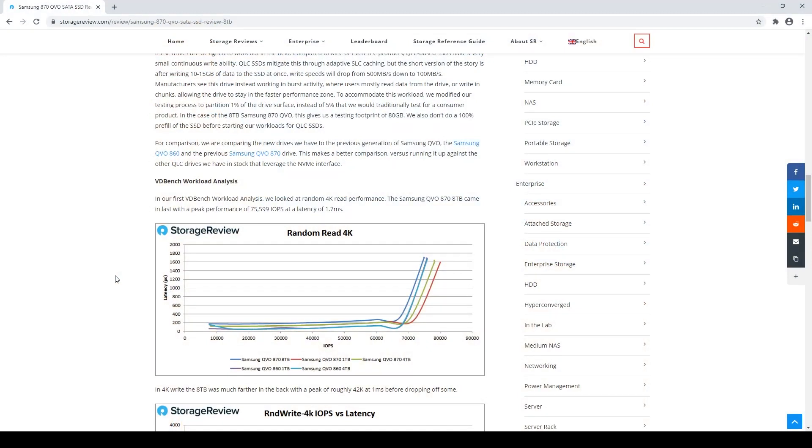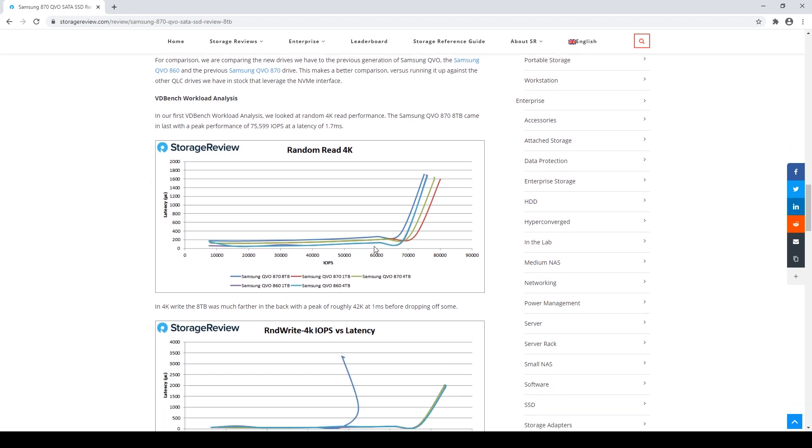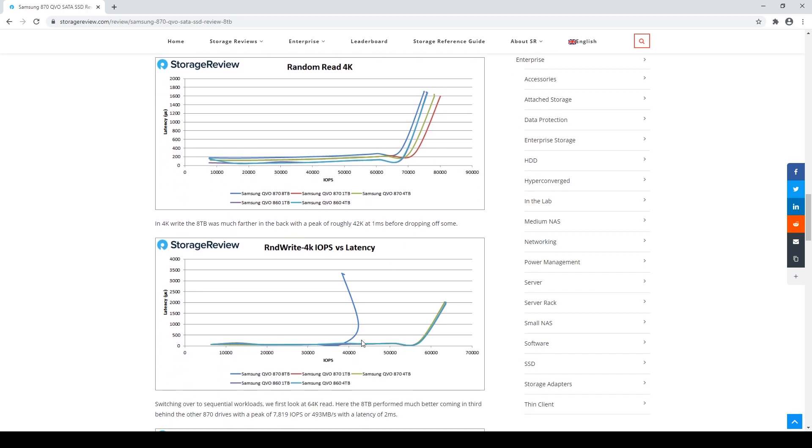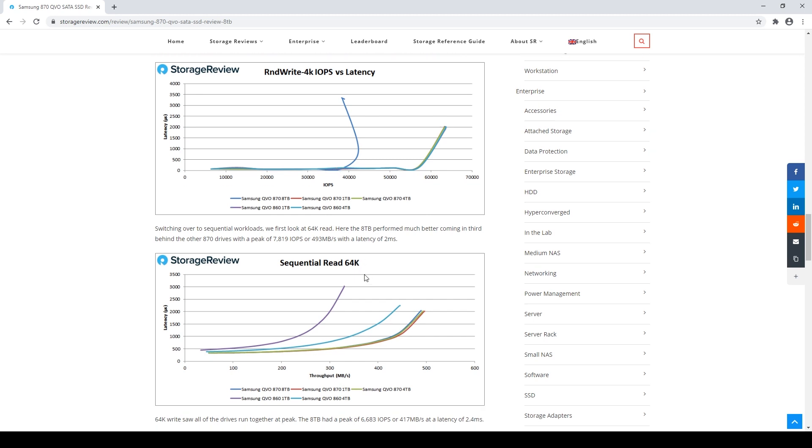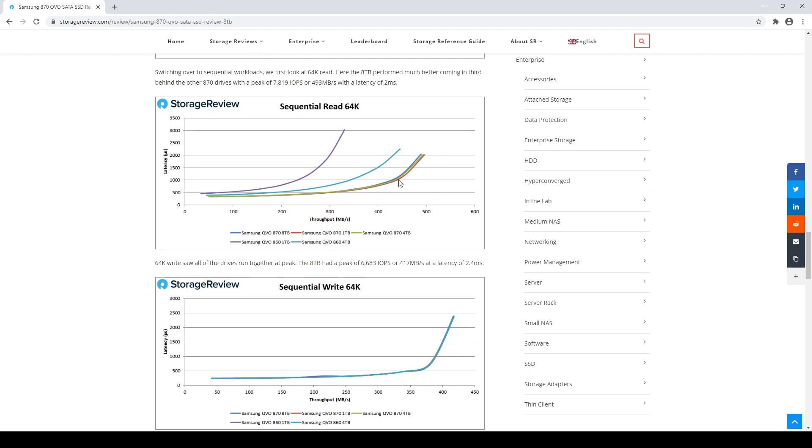Let's take a look at the performance. Overall, the drive starts out okay but then we see some erratic behavior. The random read performance is pretty good — it levels off closely with the other QLC SATA Samsung drives. The random write performance, though, really curves off compared to where the rest of the group comes out. We've seen this before where certain capacity points don't offer the highest performance — certain NAND configurations have a performance hit based on alignment of NAND lanes. Sequential read and sequential write are basically right in lockstep with the other models.